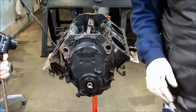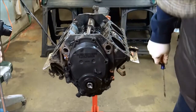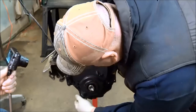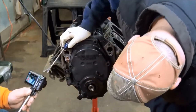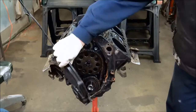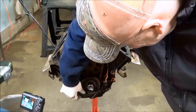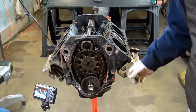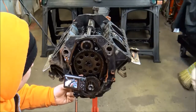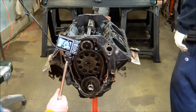Let's pull her off and see what kind of slop we got in the timing chain. Oh that's right, this connects to this — the oil pan gasket popped out. Here goes the chain — oh that's sloppy! Look at the little baby teeth on there, little tiny teeth. At least it's metal — remember the Buick used nylon teeth on these. I'm kind of happy that it's metal, and there's the gear.